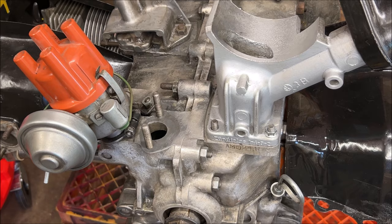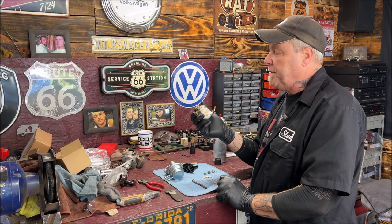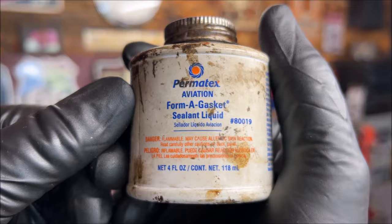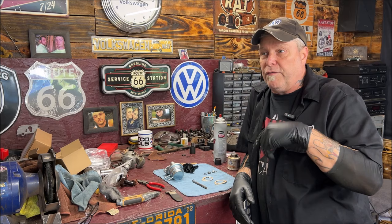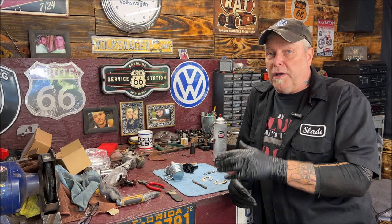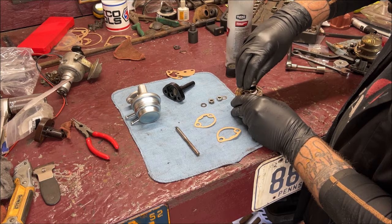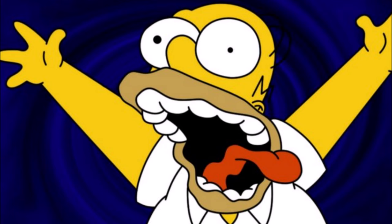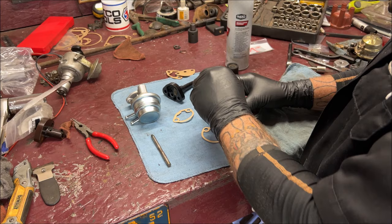Don't forget to pull your rag out. Now we're going to get ready to put the gaskets on so we're ready to mount this. I like to use Permatex Aviation Sealer — you can see the part number right there. This is what I like using; it works very well. Use what you want, but don't go sticking real thick Permatex or Form-A-Gasket or anything crazy because you'll get it inside the motor or up inside the fuel pump. Just need a little bit — just enough to make that seal work.